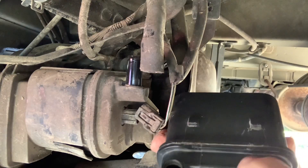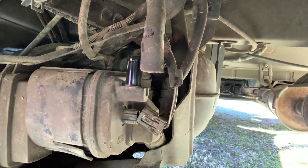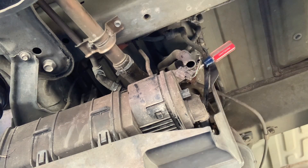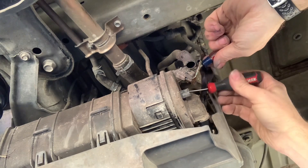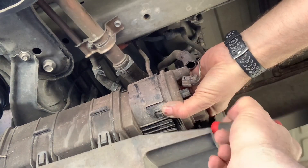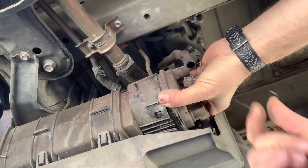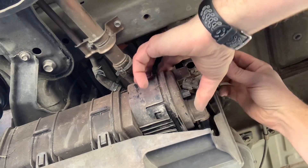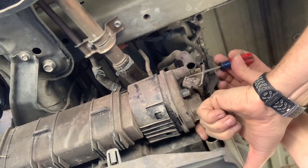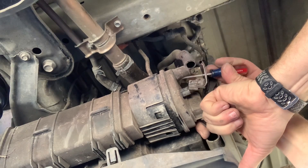This is our valve going in from the junkyard. There are four tabs that hold this valve in, and we're just going to pull them back and slide it out — it can be a bit of a trick to get them all worked out at the same time. The trick I use: work your screwdriver under the top one and leave it in there, get another screwdriver and work it under the other one, then you can work on the bottom ones. Keep constant outward pressure on it and it'll eventually turn loose, with only one left holding it in.